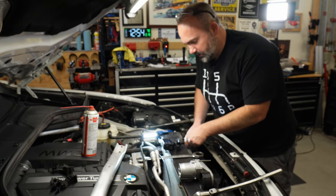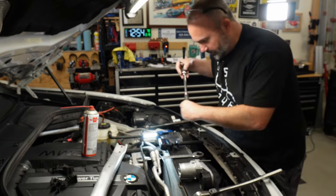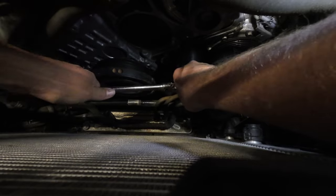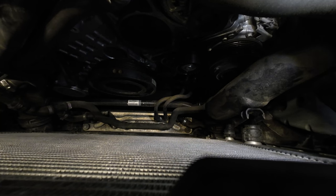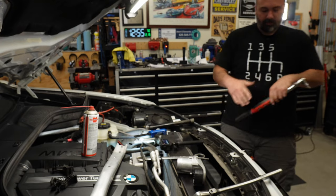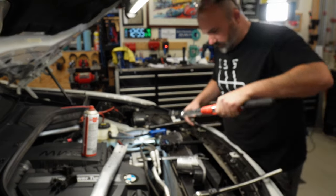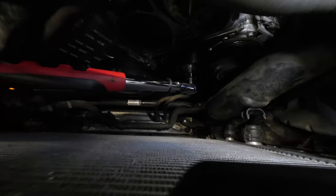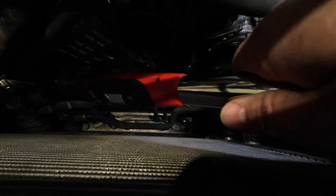This is a captive bolt in the pulley, as we discussed when we took it apart, so the pulley is going to rotate a little bit while we're tightening. Moving on to our torque wrench — I've got one of these GearWrench digital ones that does angle torque and everything you could want. While you're torquing you'll be able to see how close you're getting. 60 Newton meters it is — 60.7.